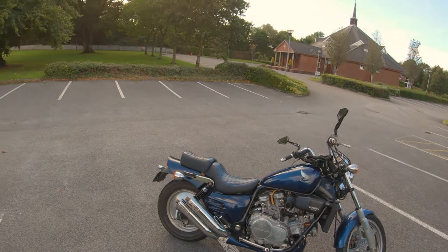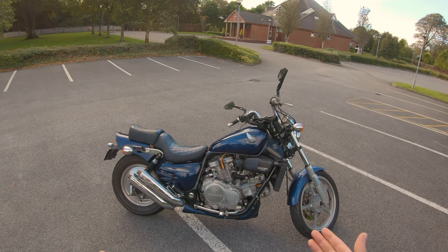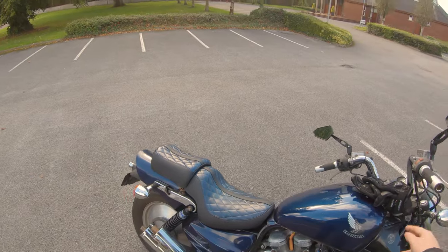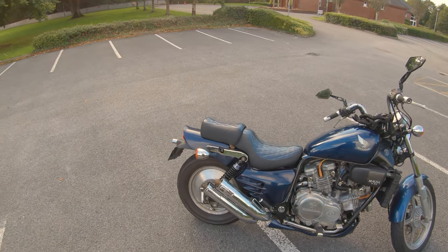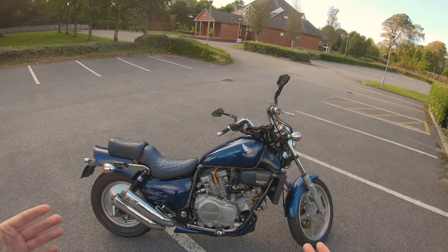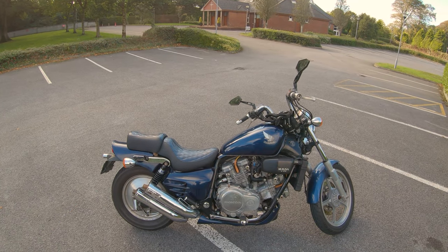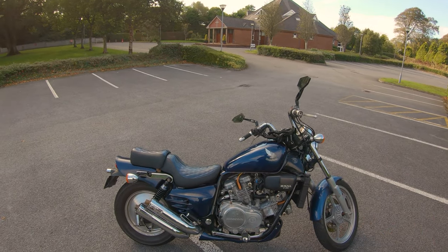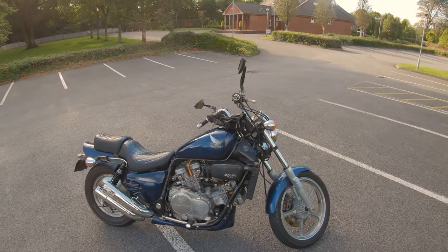Cost-wise, you can still get these and they're not that expensive when they do pop up — it's more about when and if they pop up. Final thoughts: I love this bike. It's definitely my favorite bike that I own personally. It needs work — wrong grips, tatty bits here and there — but it's all going to be done. The cool thing is I can ride it while I do stuff to it. I've put on new Hagon shocks, redone the braking system, changed all the spark plugs, and done a few other bits — all in the interest of keeping it running until I can do a full blow-apart and paint job. For now, it's absolutely perfect for my needs.